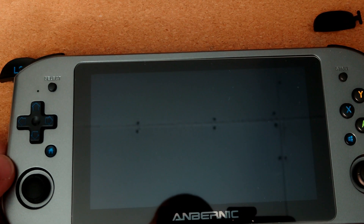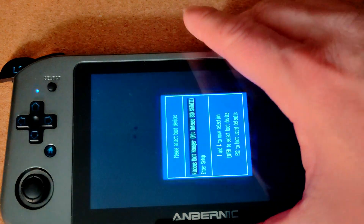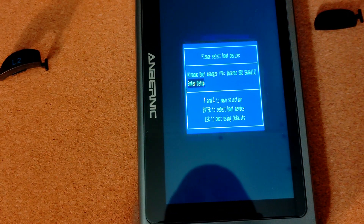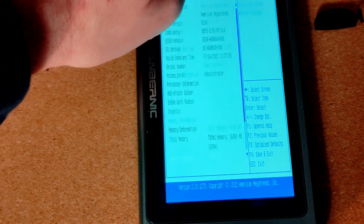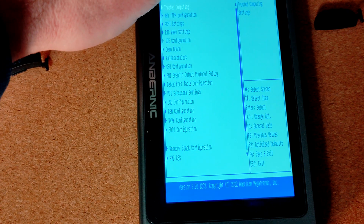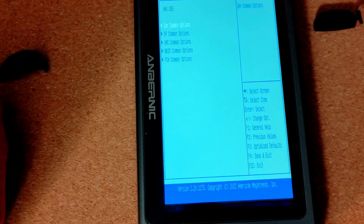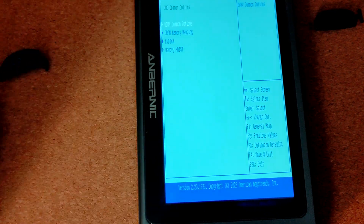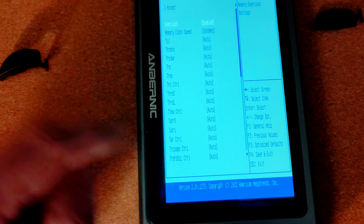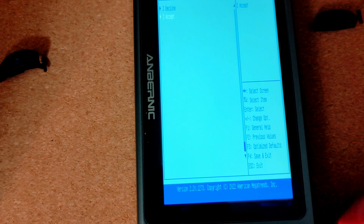We're powering on with the fan attached just to check it boots okay and then going into the BIOS. Press the power button and as soon as the white light comes on at the front, push volume down and you'll get the boot menu. The Intenso one-terabyte drive has popped up and we can see we've got 16GB of RAM - good news. Checking AMD CBS in the settings menu, then UMC Common Options: the clock speed is set to 1600MHz, which is half of 3200MHz - correct for DDR double data rate.